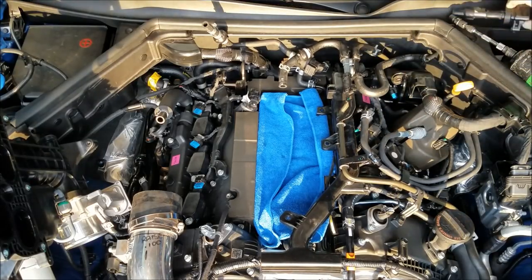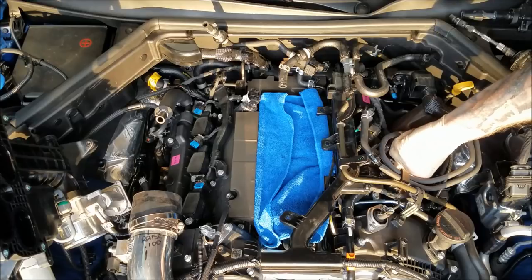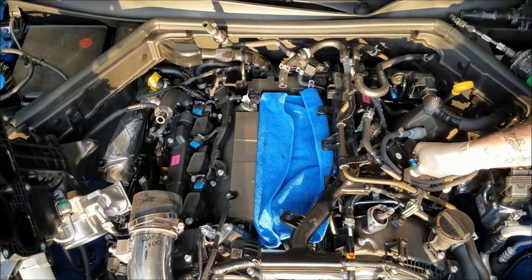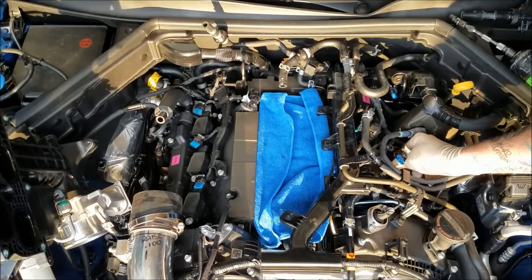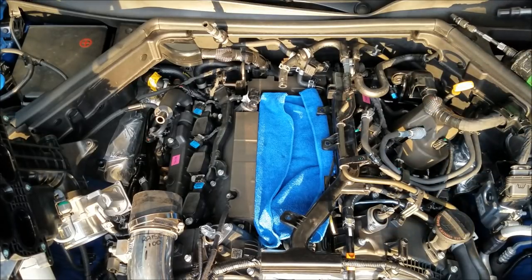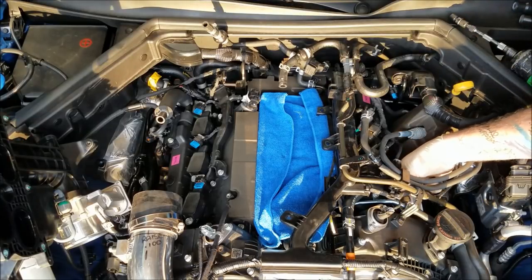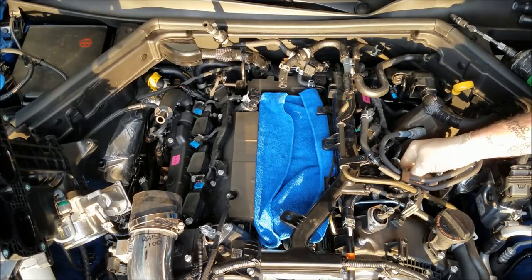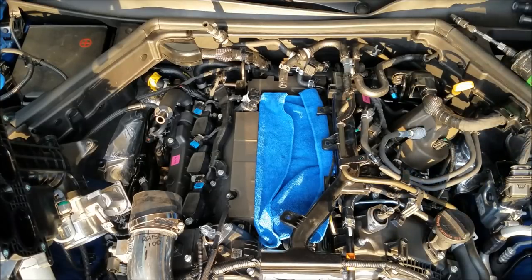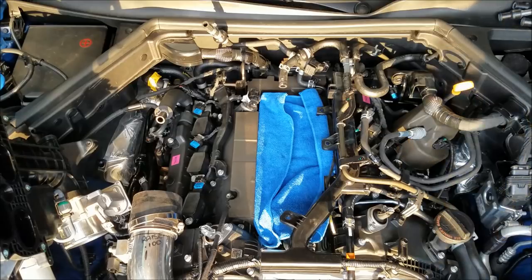Okay. All right, coil number one out. Not cylinder one, just coil number one out. Normally I like to keep the coils matched up to the cylinders. So when I stack them, I stack them on the cowl in the orientation that I took them out, front to back. That coil was a bit of a bear. Those look good though. So now we got those three out. Come on over here and get these three knocked out.